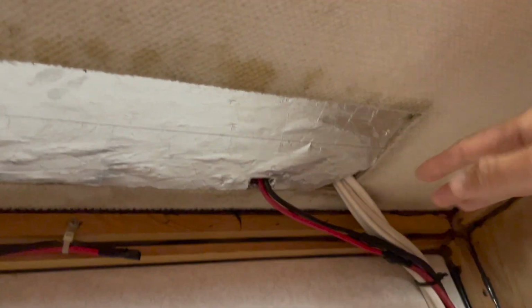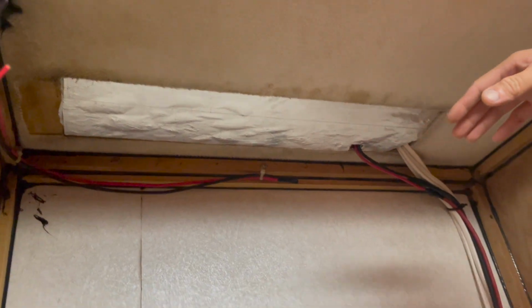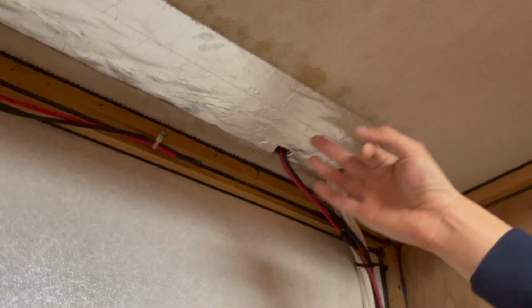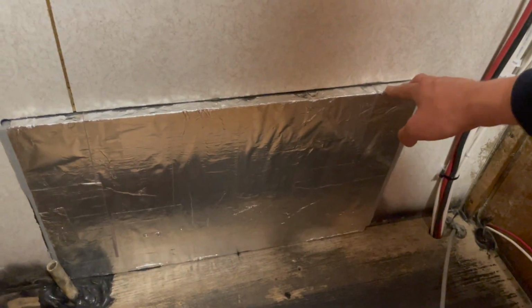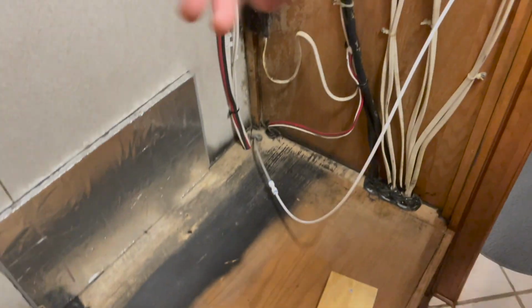And for the vent, I have sealed that on the rooftop. I removed the vent entirely, and then put one aluminum panel on top. And then here I use the foam boards in this area. I use three 1-inch thick foam boards cut to fit the hole here. And on here, there's another vent, and this is the added foam board. And also for the vent door itself, I have some spray foam on there to be further sealed.